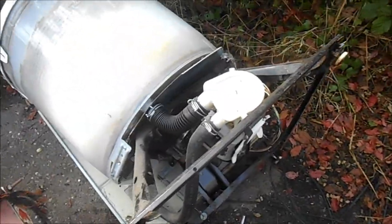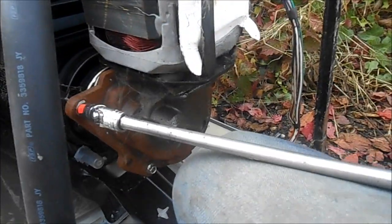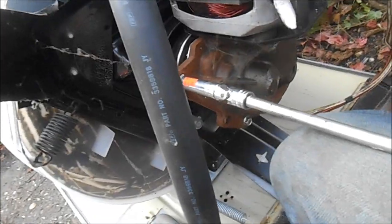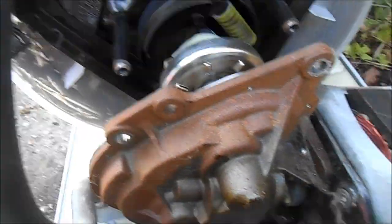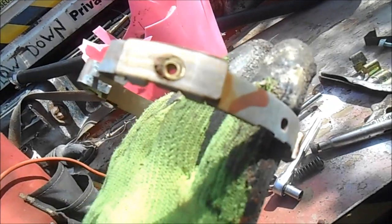This is a continuation on this old-school direct drive — it's got this kind of top with the split here, two clips on the front after you take the two screws out of the console. This one basically has a failing clutch so it just won't spin very well. We're going to take this transmission out and take a look at it. You have to take the agitator off first, then take these three half-inch nuts off and pull the transmission out. I had a hard time pulling it all the way out, but all we need is a little space to grab this — it's sitting inside there with that little spring on it, and you can see this clutch is kind of worn out, with the brass rings rubbing.